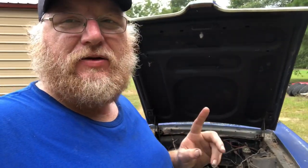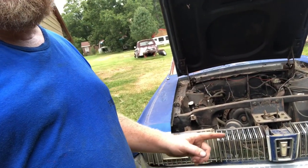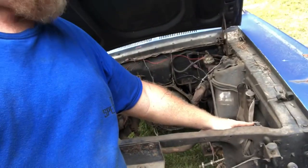Here's the second reason why the big gnarly cam was a bad idea. All of this works off of engine vacuum and hooks to the vacuum line right there. Big gnarly cams don't make any vacuum in a motor. This is going to be a street car where we need the headlights to work and stuff. When I started out building this, I think I was building it a lot like it was going to be my car. The motor's got a good overbore in it, good compression pistons, good heads, decent compression, and a big snarly cam to drop in it.